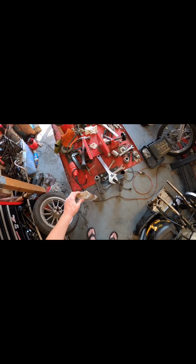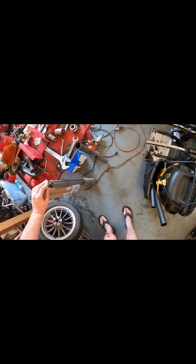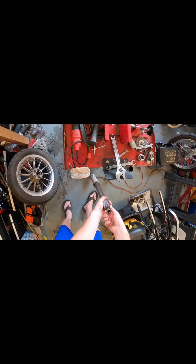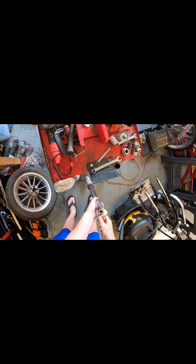So today I got my new tubes in. So we're gonna swap out these old fork tubes to this portion of the suspension. I kinda already broke this one down, but I figured I'd show you guys how to take this one apart. So there's a cap right here. We're gonna unscrew. That's gonna release the spring on the inside.